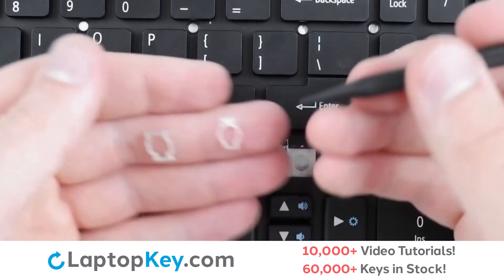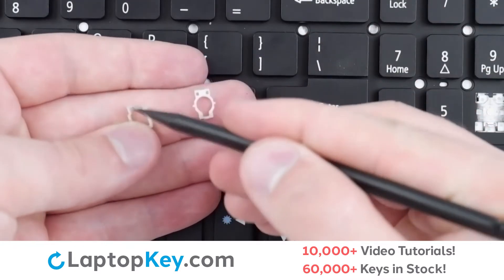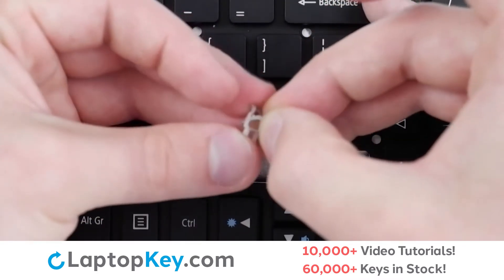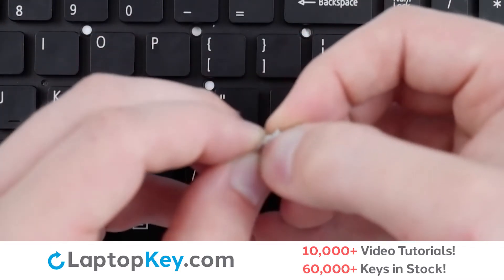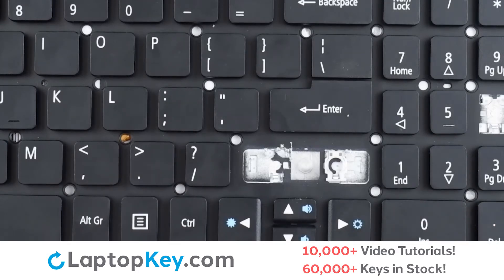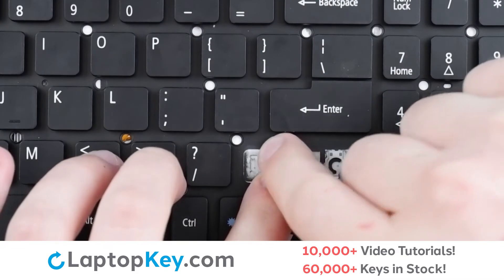To reassemble the clips, we'll begin with the top clip, which has a small divot out of the circle in the center and two holes at the top. For the bottom clip, there is an upward facing notch on the top side. To reconnect the two halves, insert the top clip through the middle of the bottom about halfway, then insert the plastic support arms into the holes of the bottom clip on both sides, ensuring everything is connected. Then, using metal hooks here, here, and here, we will lay the clip down bottom first, then apply a small press at the top.